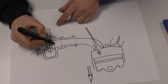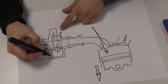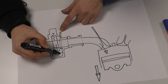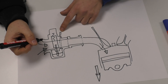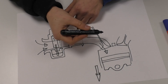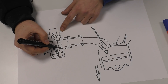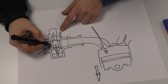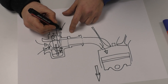Inside your carb you have a vent — imagine fuel is going in from the other side. There has to be a pressure difference; it's trying to balance itself out. As air passes past the main jet with your needle and all the rest of it, the pressure inside drops.